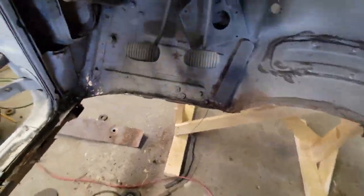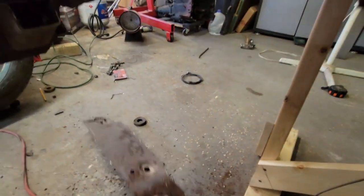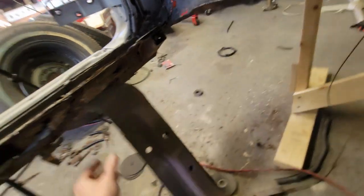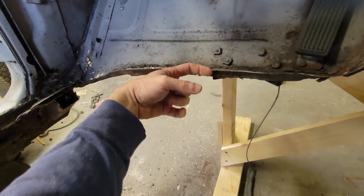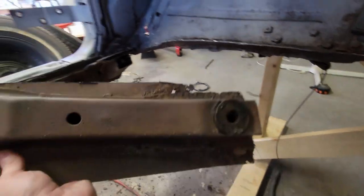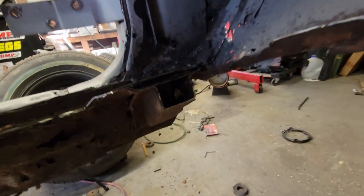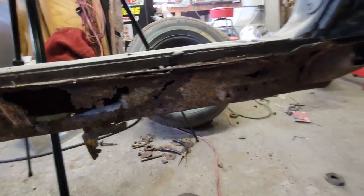Let's pause right here - I'm going to show you where I'm at so far. It's not much, not far along, but a few things worth pointing out. This is on the driver's side, and this is the first beam underneath the floor pan. It goes from here to here, just a little off the toe board. You can see this was structurally sound for the most part, though there's some flange work that might need to be done on both sides. It's still pretty solid against the inner rocker panel, but check it out - it's just bad.